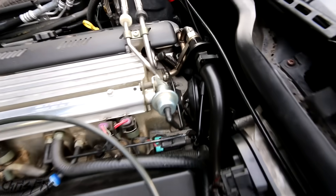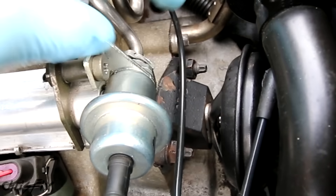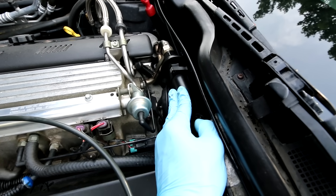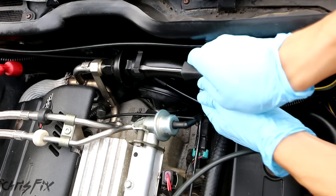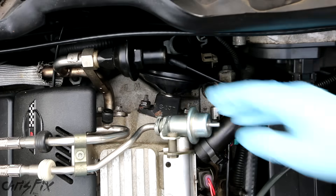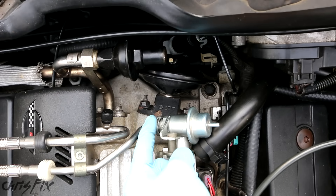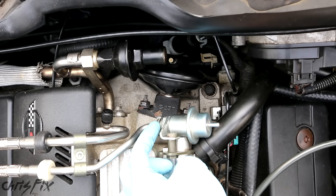So now we're back at the Corvette. Let's go remove this EGR valve — it's really simple. You can see there's a nut there and a nut there; those two nuts come off and the EGR valve pops off. This hose right here is in the way, so let's remove it to give us more access. To remove the hose, just loosen up the clamp with a flathead screwdriver and slide the hose off. We're also going to remove the vacuum line hose for the fuel pressure regulator. Now we have a clear shot at the EGR.